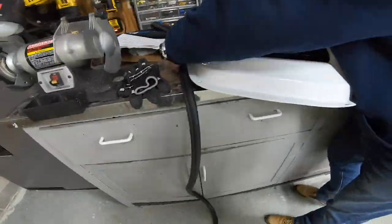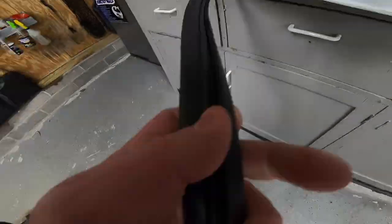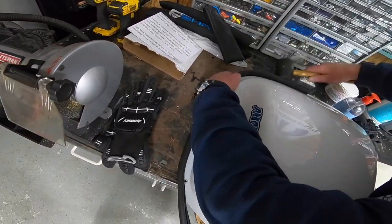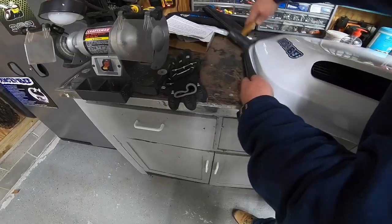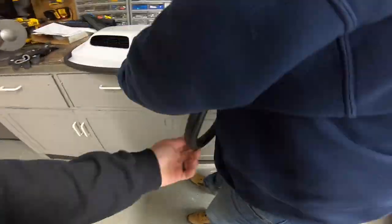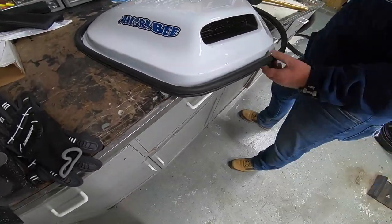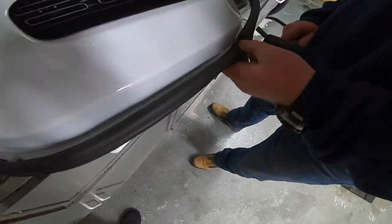If the notches are off center, it's not because they're cut wrong. We found that we just maybe pulled it a little too hard. As we backed it off and pushed it forward again, everything kind of lined itself back up. So just be mindful of how much you're stretching the gasket as you're putting it on, to make sure all four of those areas line up with each other.